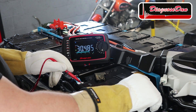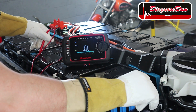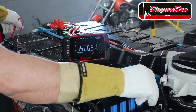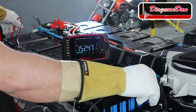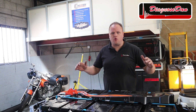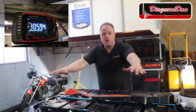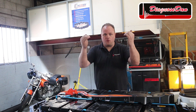Let's take some voltage measurements at the modules. If we measure one module we see about 30.5 volts. Let's add two more and we see 91.5. Let's measure the voltage across five modules — the total voltage across five modules is 152.5 volts. A voltage of 152.5 volts measured across five modules means a total battery voltage of 305 volts across the total of 10 modules. If we want to work safely on this high voltage battery, we want to bring that voltage down.